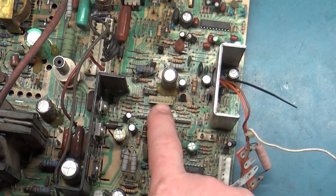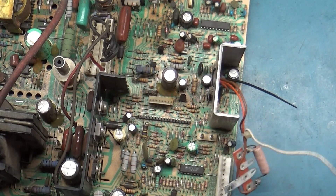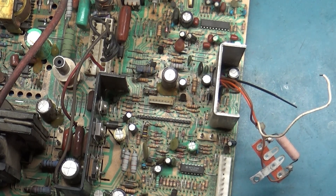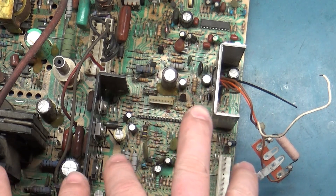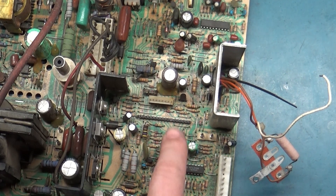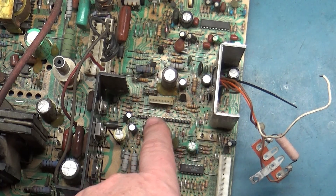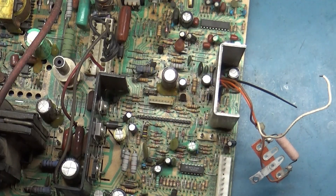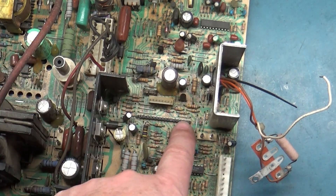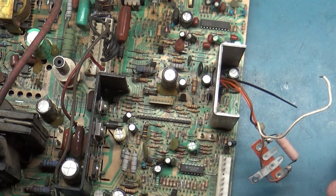I have to grab the remote board, and then we'll cut this off. Make sure that stays out of the way, then I guess we'll go ahead and hook it up to a tube and see if we can duplicate the problem — because the normal everyday causes all check out good. Unless it's a bad cap or a bad solder joint, I'm not sure right off. But it very well may be that they don't have the remote board installed — if that's the issue, then something else could have been damaged. Because the vertical IC is okay and everything else that normally causes collapse is okay, I'm leaning toward the remote board not being the problem. Let me get my cutters, hook it back up to a tube, and turn it on.